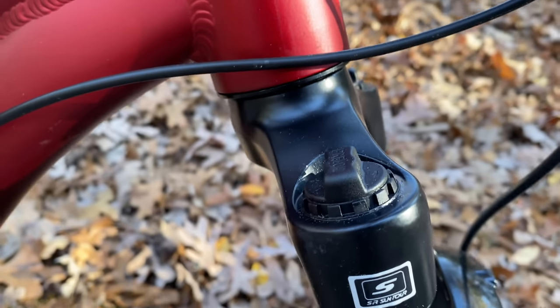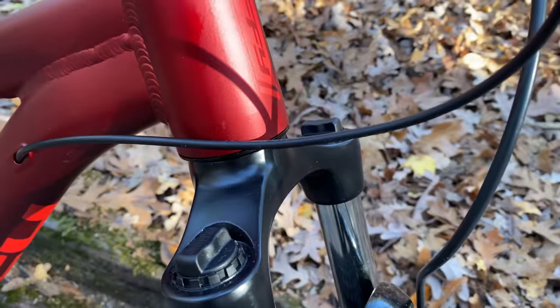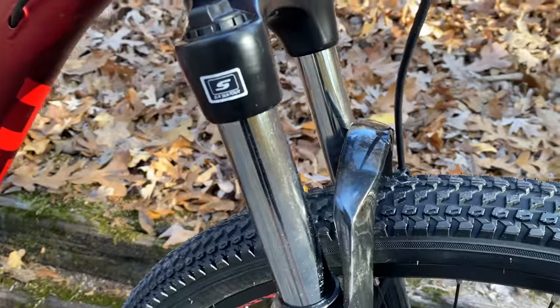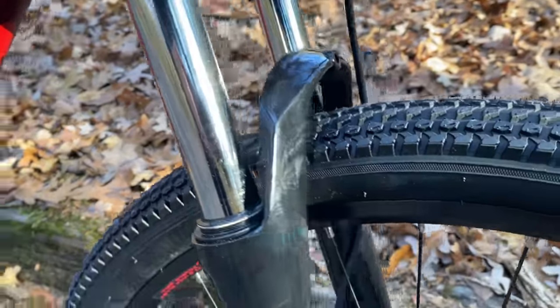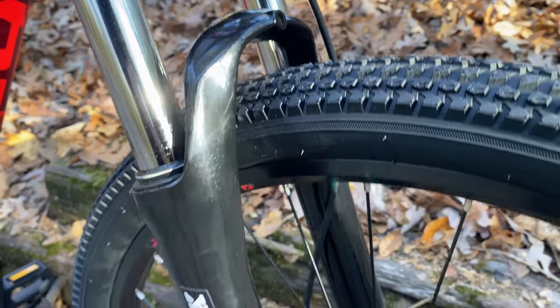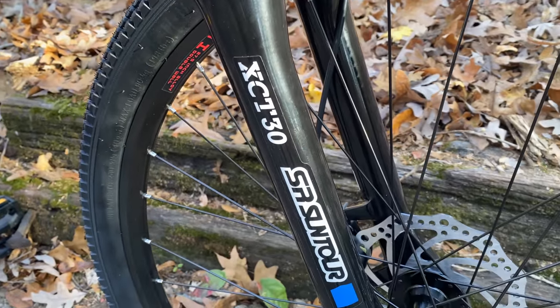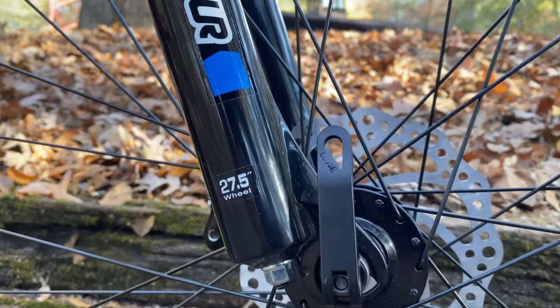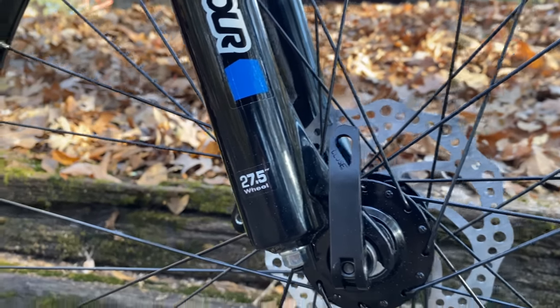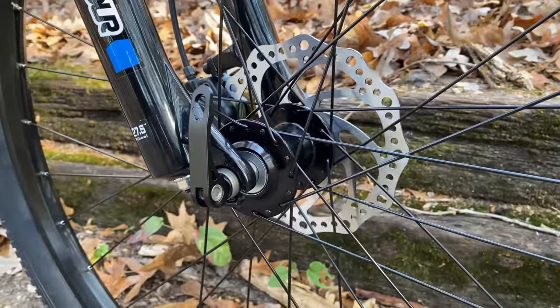The Dakari's fork — it's not tapered but it's still from the Kev Central basic trail-capable list: an SR Suntour suspension fork with dual preload adjusters, 100 millimeters of travel, and 30 millimeter stanchions, hence the name XCT30. No bolt-on wheels here, also no thru-axle — this is a standard quick release.